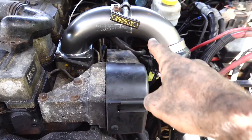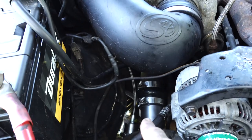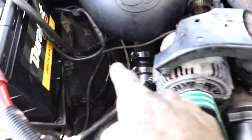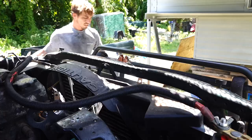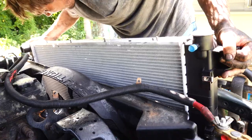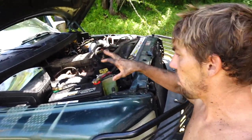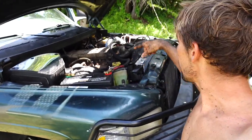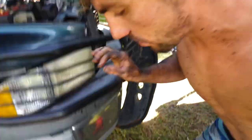Some of the audio got messed up during this part, but here's the new Pusher intake manifold, the tubes and silicone boots, and one of the tubes off the turbo side. We just filled up with coolant — the radiator is in, all the Pusher intake components are on with hoses, water pump and thermostat are in, coolant hoses are on. We're going to start the truck, let it run a little to work the air out of the system, then top off the coolant. Hopefully no leaks — there were none as I was filling everything up.